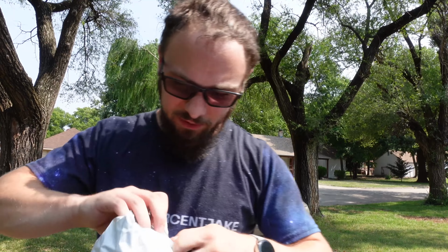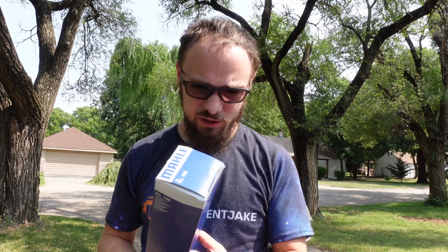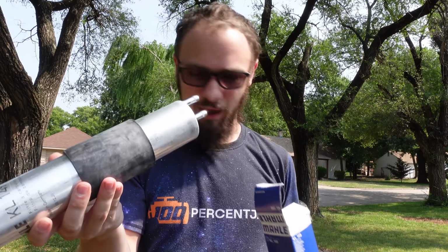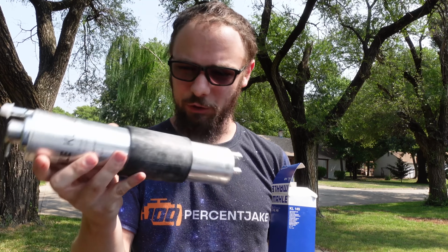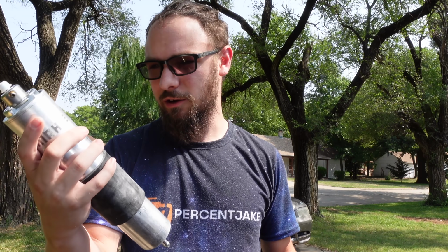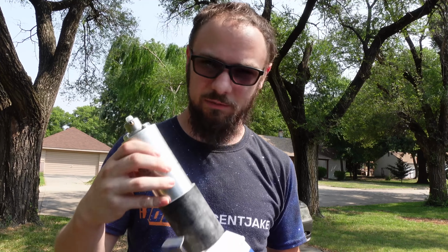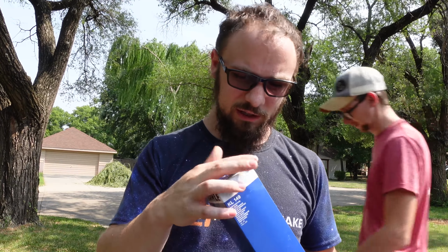I also bought a new fuel filter because let's just do a full fuel system service on this car. I've already checked my fuel injectors previously, and I got this new fuel filter. I can't get over how ridiculous the filters are on these. And of course that has a fuel pressure regulator built in because reasons. Yeah, it looks about as simple as it gets to replace that thing. Just involves some rolling around on the ground, but let's get that old sending unit ripped out.